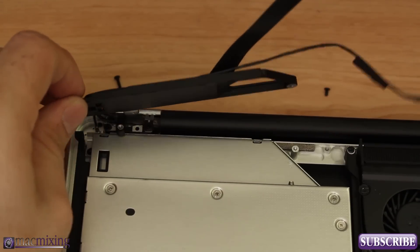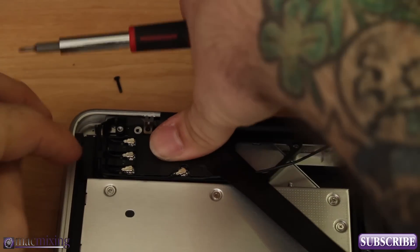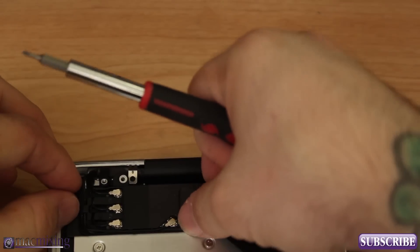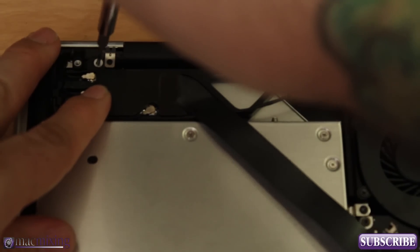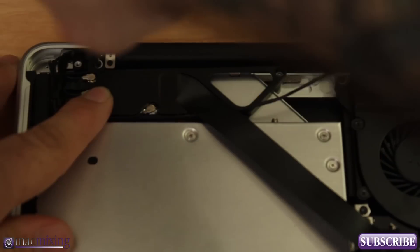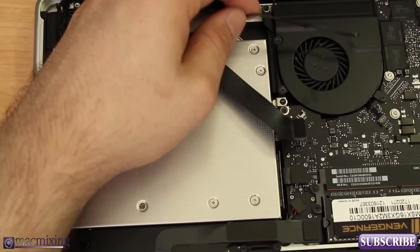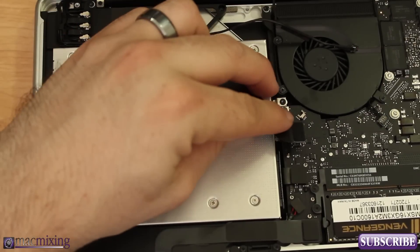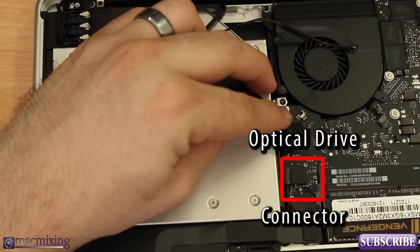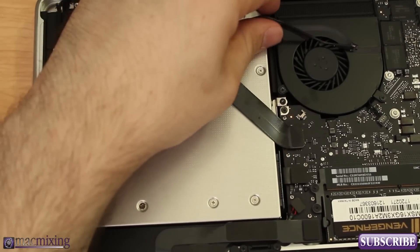What you want to do next is take the little piece that we moved out of the way earlier and push it back down into place, then screw those pieces back down. This is where remembering where you took the screws from comes in handy — take the screws and screw everything back together the same way we took it apart. Now we want to reconnect the two little connectors that we previously removed. Don't forget the optical drive connector right there in the middle — make sure you connect that too. Just press them down gently; it doesn't take much at all.